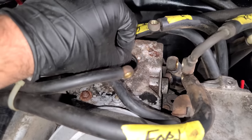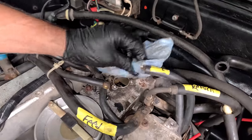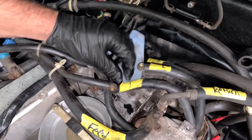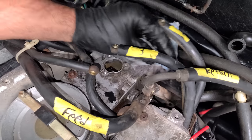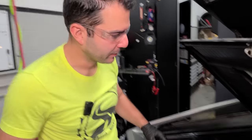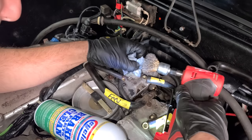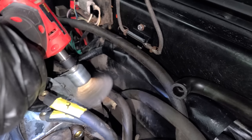Before we replace the distributor, we are going to replace this seal and do some cleaning. Put a little brake clean on a rag and kind of clean outwards here. I don't want to get anything inside. And really the only sealing surface is where that O-ring is. This is all just kind of dirt that doesn't matter too much. Who am I kidding? No, I got to clean this up. Blocking up the hole though. Who else knew that was going to happen? Ugh, got to be smarter.